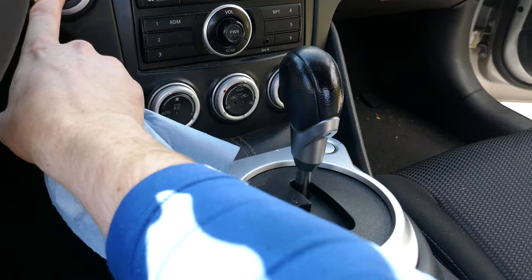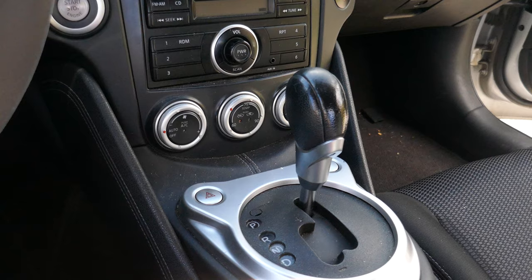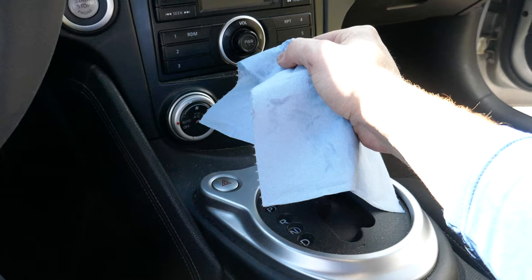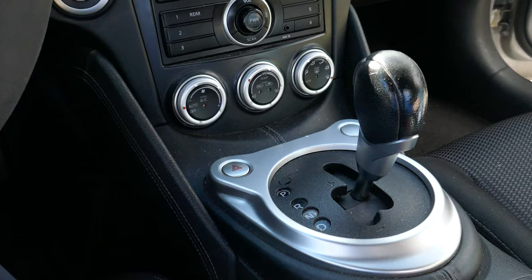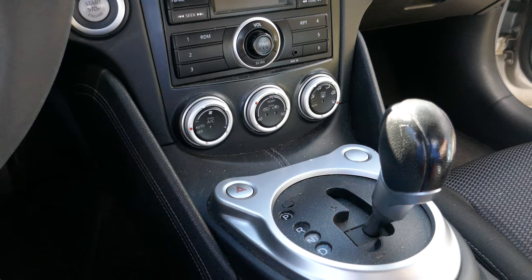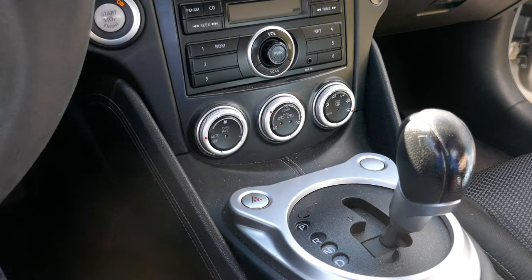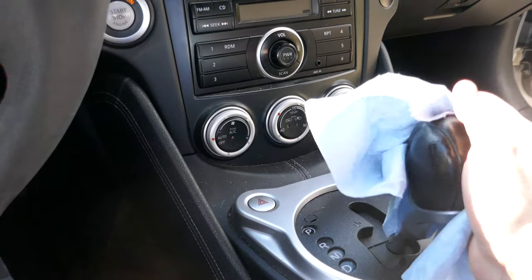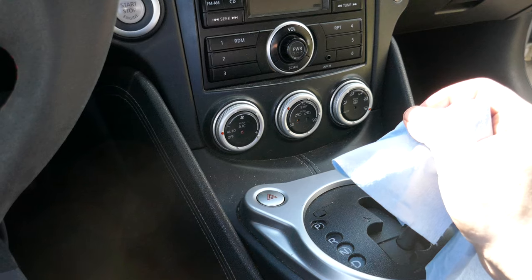As I'm jacked up, I'm currently starting the car, and we're going to spend a couple of minutes in park, and then put the transmission through its different positions. So reverse, and spend a minute there. Neutral, spend a minute there. Drive, spend a minute there. The goal of this is just to make the transmission fluid go through the whole transmission and fill all its passages. Then you go underneath and check whether you can fill it with more. I did that a couple of times. So now we should be ready to go and test the transmission because the fluid is full.